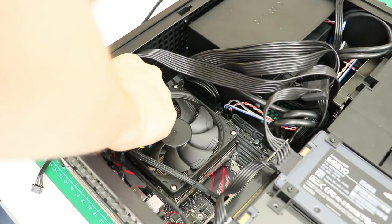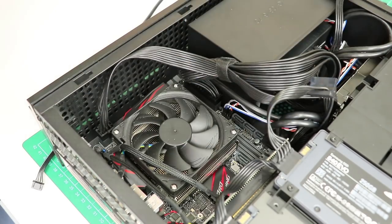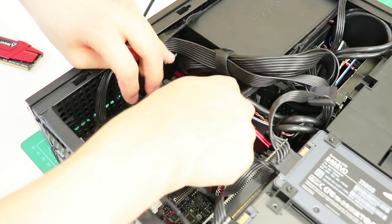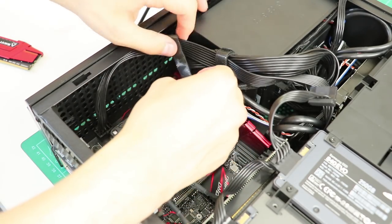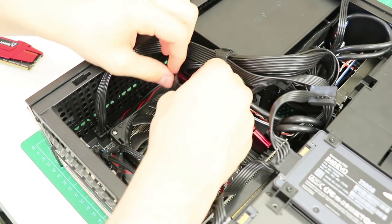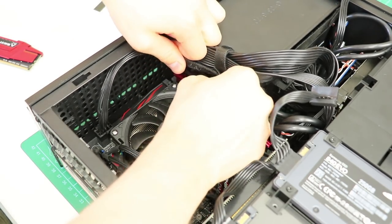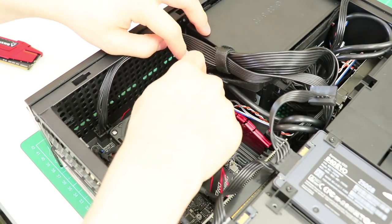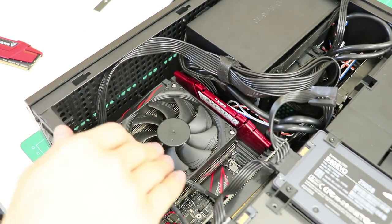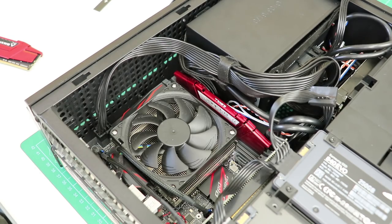It's not the amount of cables that's causing an issue at the moment, but more the rigidity and the memorized curves of cables from a previous build that are pressing against the far RAM stick. So at least for now, I've strung a few Velcro straps together to hold them in place tight against the power supply unit bracket. Actually, some cable management loops wouldn't go amiss here as standard, a thought for future revisions perhaps. You can never have enough cable management loops.